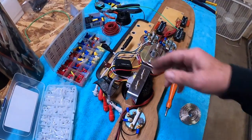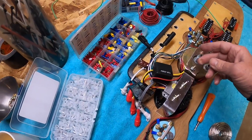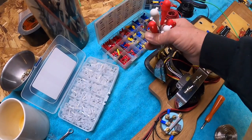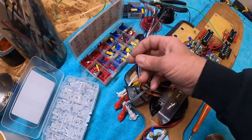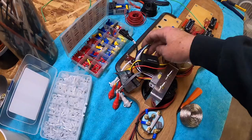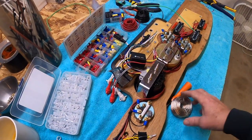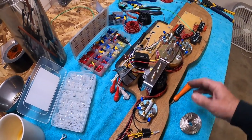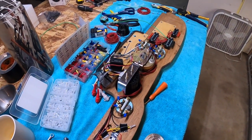My gauge radio is on the bench with power connected, ready to plug into the wiring harness. Here are all the RCA jack outputs for subs and other good stuff. Next I'm going to connect the speaker wires for left and right channels — I think I'll just have two speakers in the rear, back at the seat line. It's much easier to do this wiring while it's on the bench than when the dash is in. Looking good — a lot of progress.